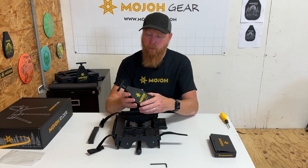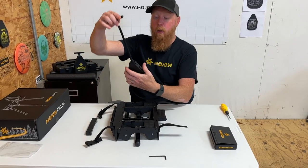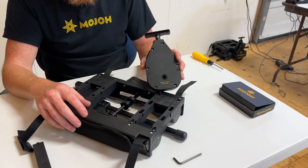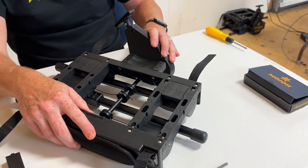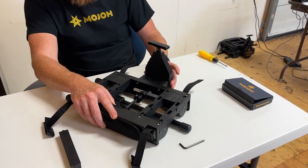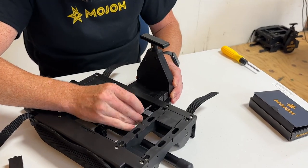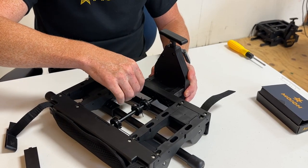Take your face plate and make sure the handle is all the way down. If you did pull it all the way out, push the button where it locked and feed it back in — we want to assemble it with the handle down. Now take the drive and line up the teeth of the drive with the slots on the drive shaft. Hold it at about two o'clock, slide it on, and then rotate it up to vertical. Take the allen wrench and screw in these long screws — they're going into nuts in the front plate so you can get them nice and tight.